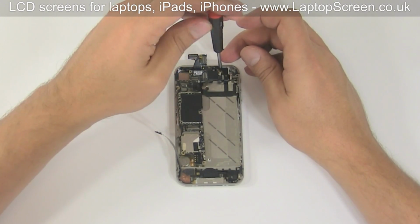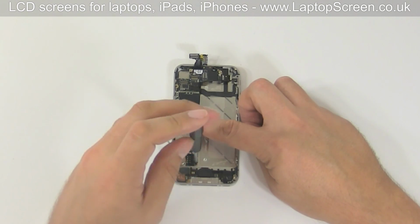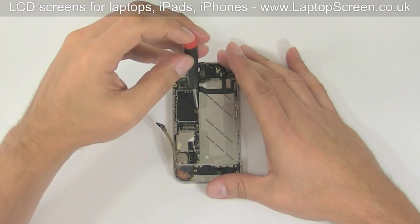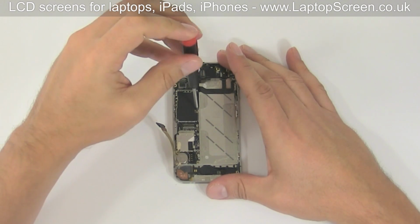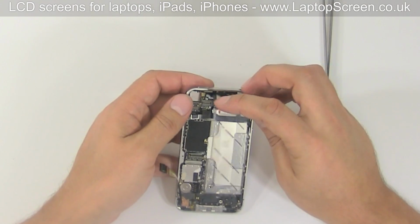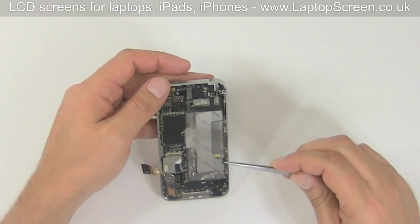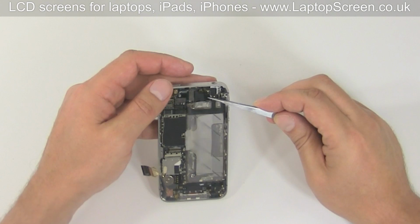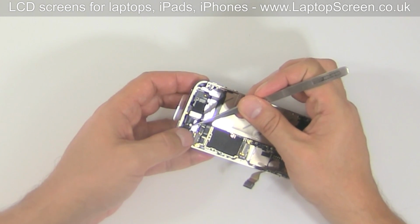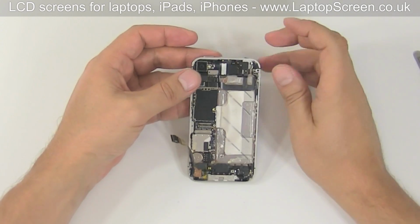Secure the top right and the bottom right logic board screws with the flat screwdriver. Replace the top left screw, the mid-level right screw and the bottom left vibrating motor screw. Reconnect all 6 loose connectors back on the logic board. Replace the grounding piece over the cellular antenna. Fold the insulator over the top left logic board screw and replace the rear camera.